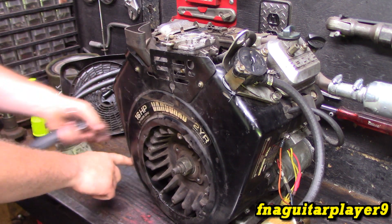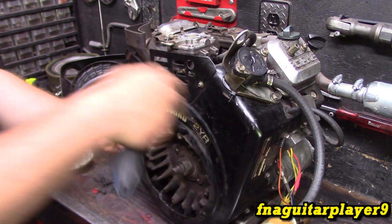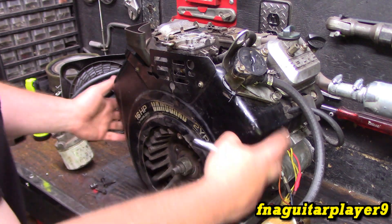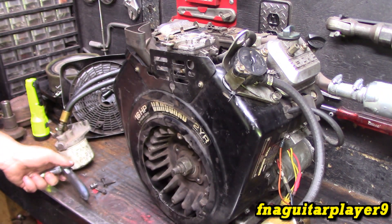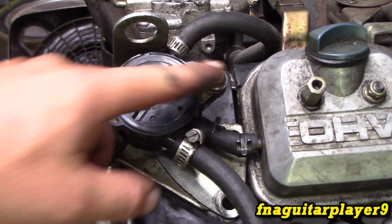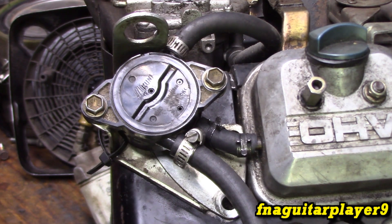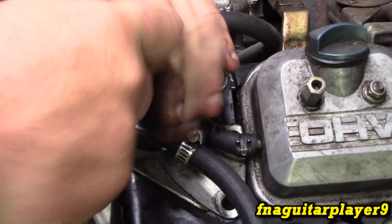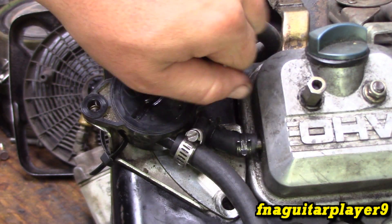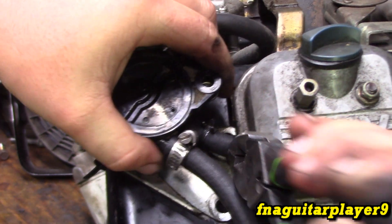You've got two 10-millimeter bolts on one side and two over here, and the others are 12s or 13s. In order to get to the last bolt you do have to remove the fuel pump - you can get by just taking the two bolts loose and folding it out of the way, but I want to take it completely off to make it easier. Take these two bolts out first, then take the vacuum line loose from the valve cover.